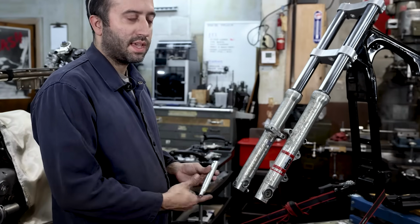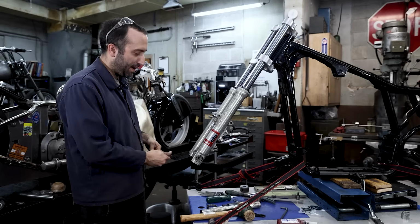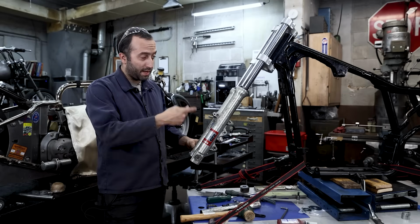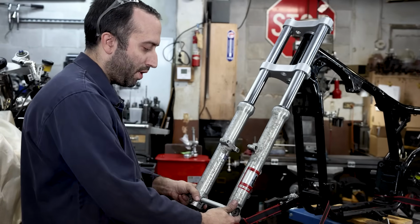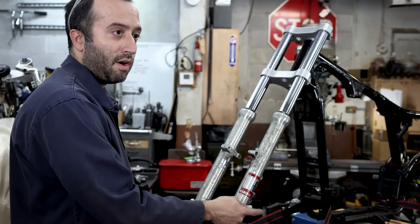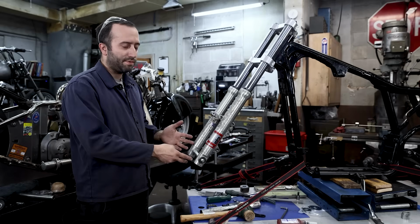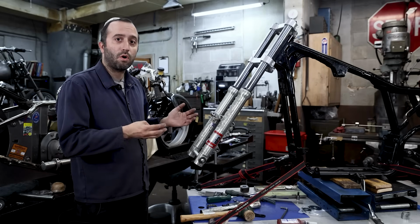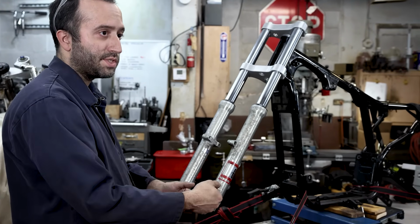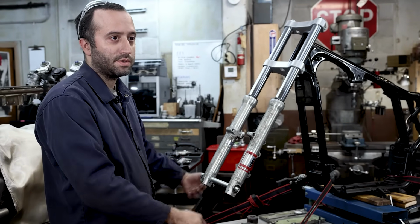So here's the axle that comes with this kit that's used for this specific version, the narrow trees with your stock lowers. And it works just as your previous axle, except it's 1 inch shorter to accommodate for the narrow trees. And it fits in just the same way. This axle only bolts in one way. There's one hole that's larger on one leg, and then a smaller hole for the threaded portion of the axle on the other leg. Like we said before, this is only going to fit with a 3 3/4 spool or narrower, but everything else will work exactly as stock. When you bolt this on, tighten up the axle on one side first to draw everything to one leg, and then you're going to lock down your pinch bolts when you're installing your wheel.